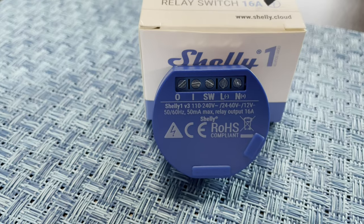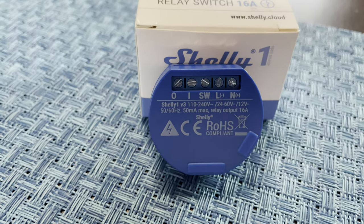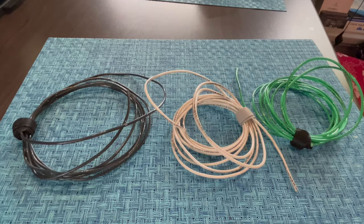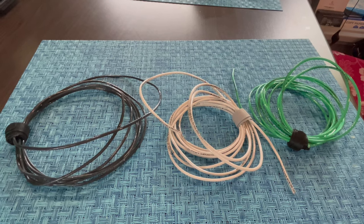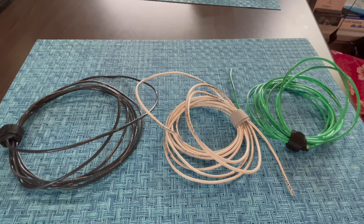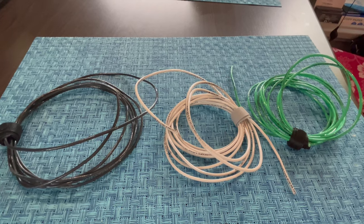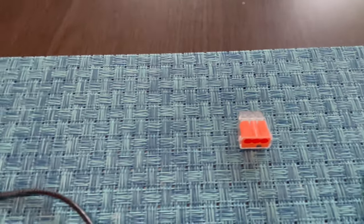You will also have a separate wire that connects to the lower connector on the light switch and is connected to the camper's ground. I purchased 10 feet of the 14-gauge stranded 3-wire from Lowe's. You will have to untwist the wires, but it gives you 30 feet total of three different colored wires for you to use in these applications. I wasn't sure how much wire would be needed, and this was more than enough for installing six of these switches. I also used the push-in wire connectors for 3, 4, and 8 wires.